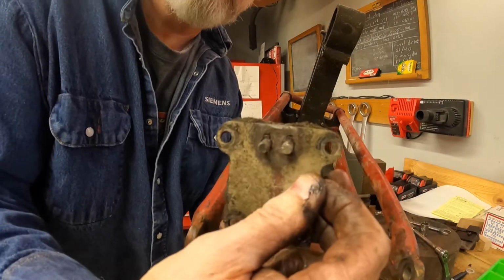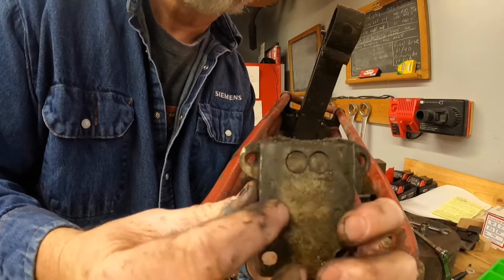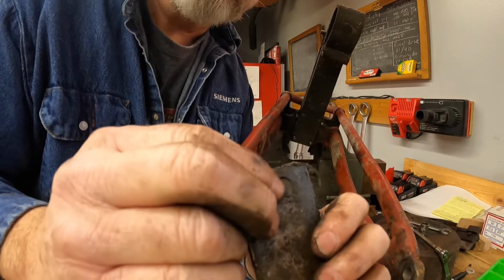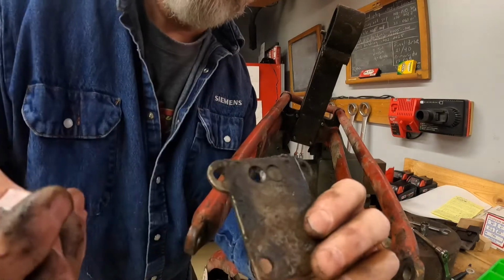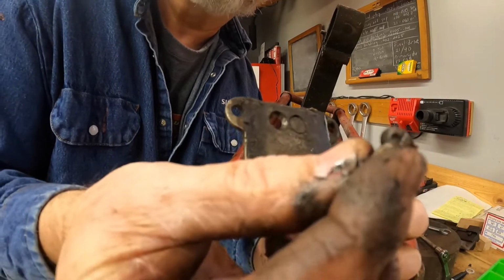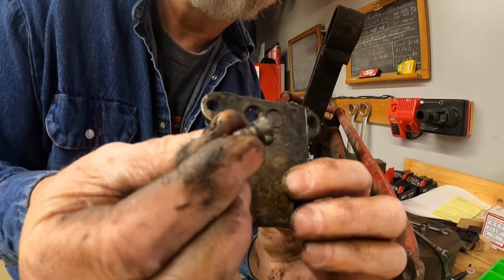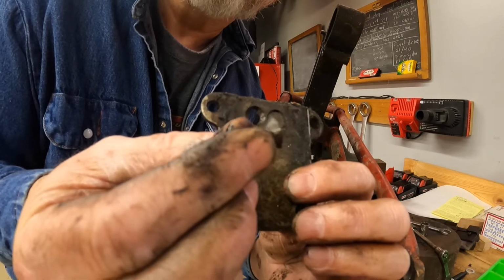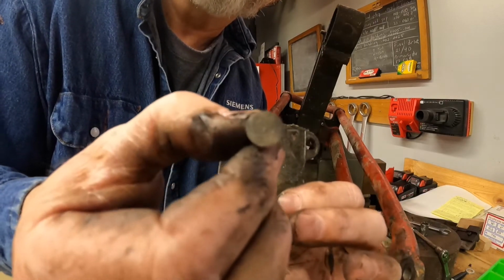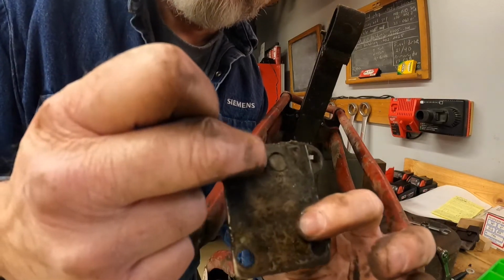These are the two bolts that hold that front fender on, the back part of it. You can see it's flat on the back. Can you see that? They're countersunk flat. And if you take these screws out, you see there's a little slot in the countersink. And there's corresponding little bumps on the countersunk screw head. It doesn't have any kind of screwdriver slot or anything because you couldn't get a screwdriver on it. It's up against the spring, but the spring holds it in this slot.